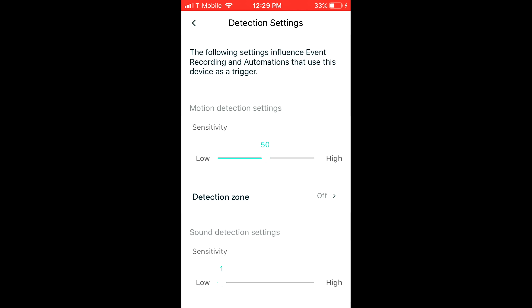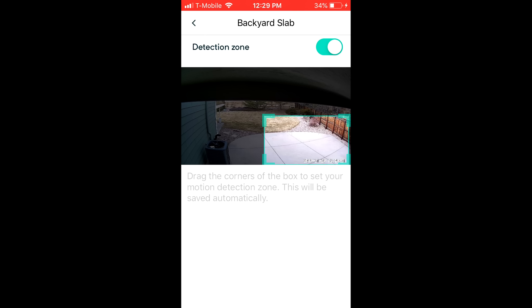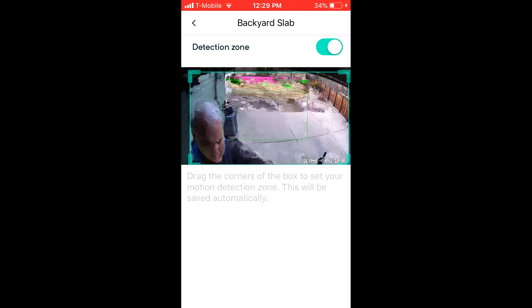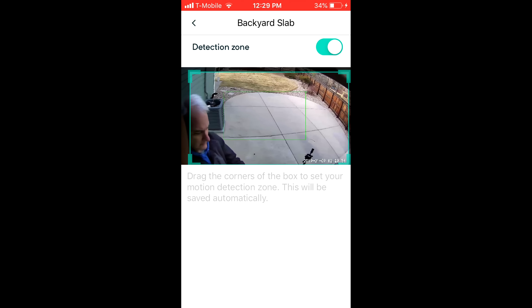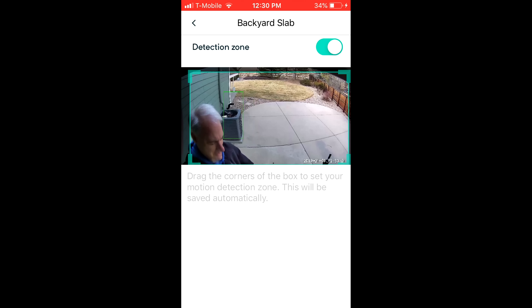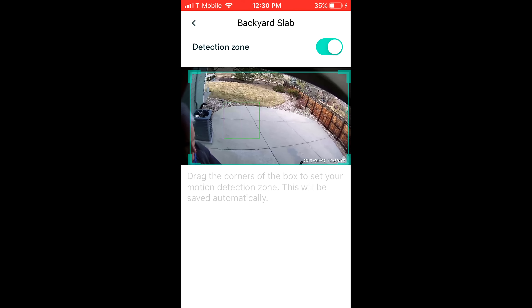I'm going to go to the motion detection settings. I usually start around 50 and then figure out the best place to put it — sometimes I'll go to 10, then 90, just to get an idea. For the detection zone, on the one I have in the front of the house I took away the detection zone where the eave was, because there's no reason to detect a moth flying up there. I don't really care what's happening motion-wise at the eave. I'm moving the camera around trying to find the best position, and I didn't really need to adjust the detection zone at all because of the way I'm aiming this particular camera.